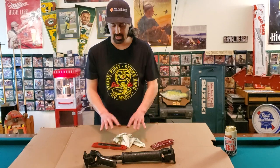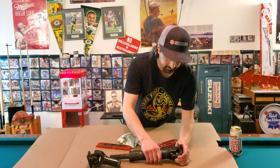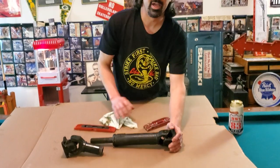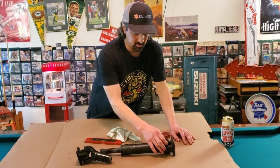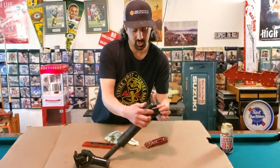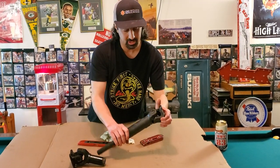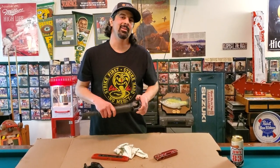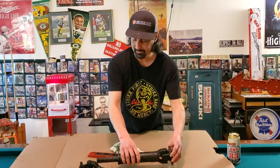So that's the first thing you want to check anytime you take the drive shaft apart — get her lined up, bolt her up. Make sure your U-joints are tight. If you can twist this while you're holding this and there's any sort of play in there whatsoever, that's a bad U-joint. You want to replace that right away, because these drive shafts are worth a lot of money — these rear ones — because people put on big tires, big lift, and this thing's at an extreme angle spinning. This U-joint will blow out and bust up the ear. Now your drive shaft's jacked up and it's going to cost you a little loot. So replace your U-joints so you don't have to spend the loot.